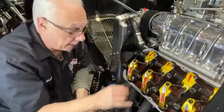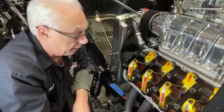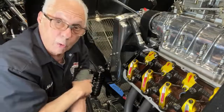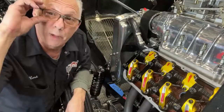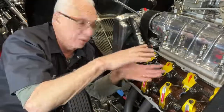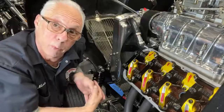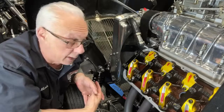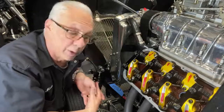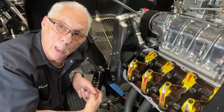Don't vary from what the manufacturers tell you. That cold setting I mentioned — these are cast iron heads, cast iron block, cast iron hemi heads. So the only difference you're seeing from cold to hot is the actual valve itself growing in length. But if you have an aluminum head — a small block Chevy, big block Chevy, or aluminum hemi head — that head's going to grow. When the head grows, it pulls the valve away from the rocker and you wind up with more lash. So you need to be aware of that, whether you've got iron block iron heads, iron block aluminum heads, or aluminum block aluminum heads — they will all be different settings. Get yourself in the ballpark when you first build the engine, go through the trouble of getting to operating temperature, check the lash hot, and then you'll know what to compensate to set it cold.